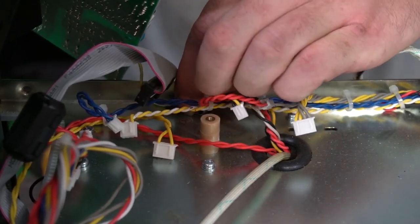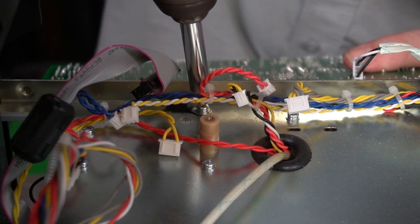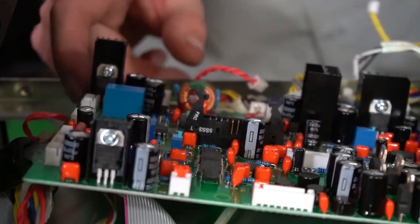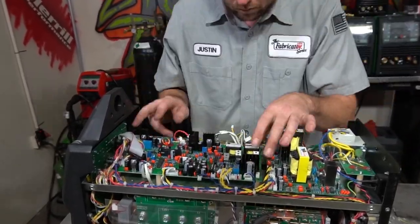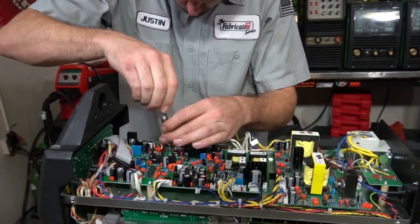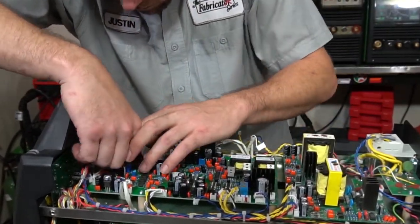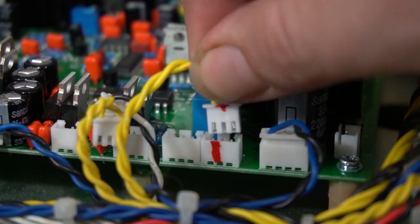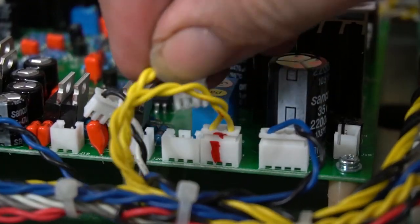To reassemble, it's the exact opposite of disassembly. First, I'm going to attach the earth lead and get that back where it needs to be. Then we're going to weasel the board back in. Make sure that all of the connectors and pigtails are out from underneath the board — they can get jammed up underneath there, and if you secure the board back down to the chassis you'd have to take it apart again, which is annoying. Make sure nothing's pinched, nothing's snagged, and it's nice, clean, neat, and even. I'm going off memory here but if I have a problem I'll consult my phone. The yellow wires we marked are lined up right back where they need to be, and generally speaking it was smooth sailing.